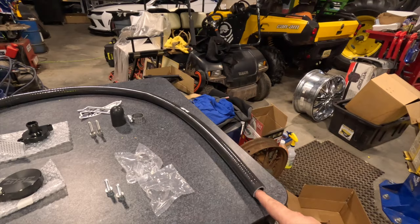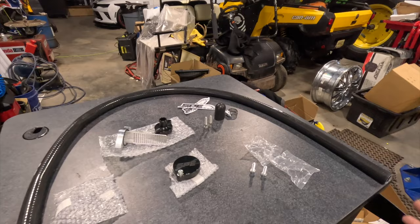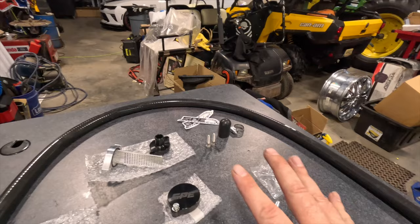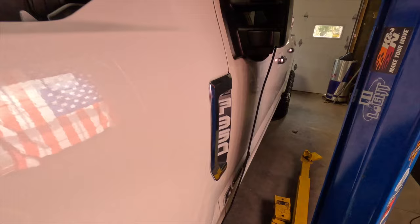We don't want a bunch of oil coming out of that tube making a mess, so what they've designed here is an internal catch can for your valve cover. You can opt for a longer tube as well. This is silicone, so it's high quality, not going to be affected by oil, and will last a long time. I'll admit this does have a byproduct - it's essentially what they call a draft tube or blow-by tube, so this vents to atmosphere.